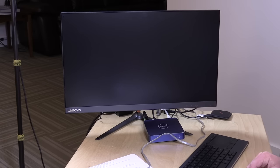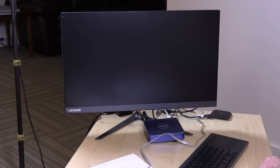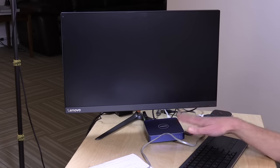The big question is will it run Linux? At the moment, the answer is no. I tried a whole bunch of different ISOs but could not get this thing to boot Linux just yet. I have seen this before with mini PCs — typically they aim to get them working with Windows first, and then a BIOS update comes out later to support other operating systems. At least with Ubuntu, I could not get Linux to boot, and I'm not going to be confident that other distributions will work either.